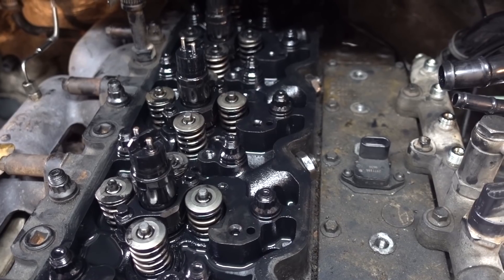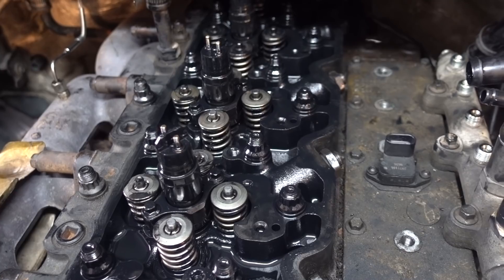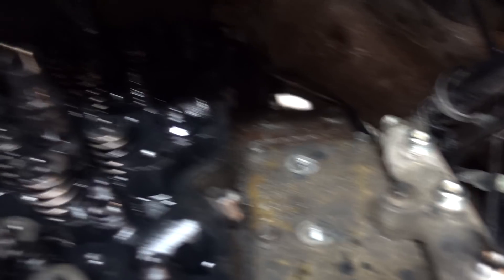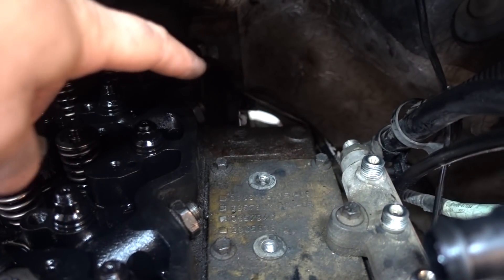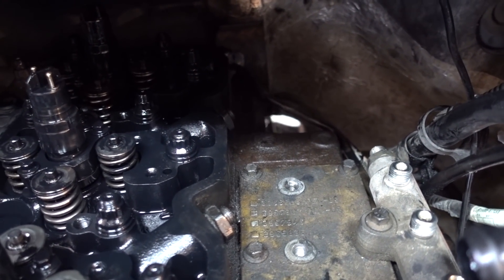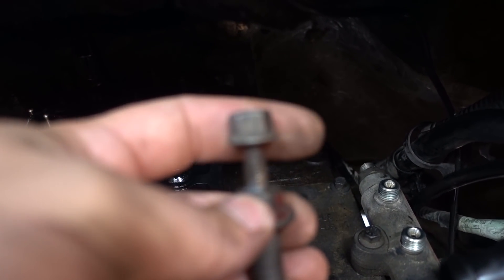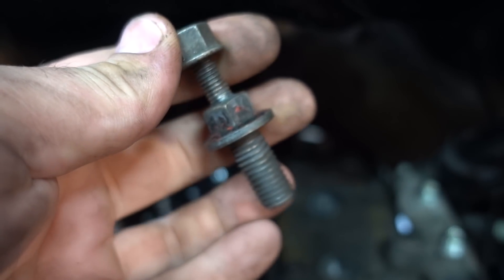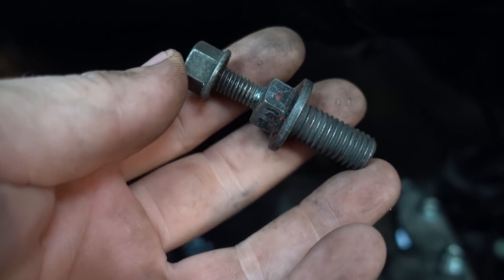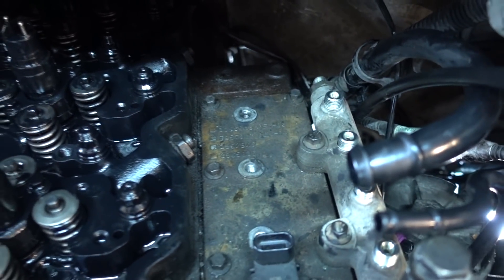All the crossover tubes are now torqued and the injectors are now completely torqued down in proper sequence. The number six injection line was missing its lifting hoist plate — must have been taken off the last time this truck was apart, and that's why the number six hold-down was not tight. I actually happen to have the bolt that holds that down with a little stud to hold the number six injection line. I'm gonna put that in first and then put the injector lines on.